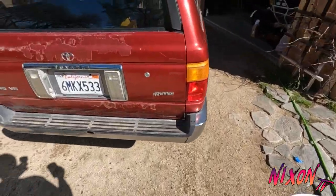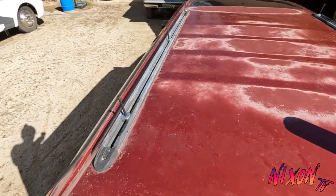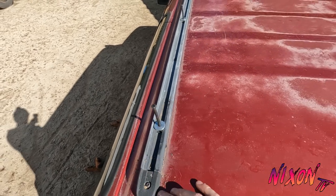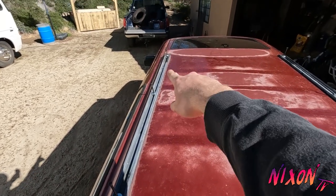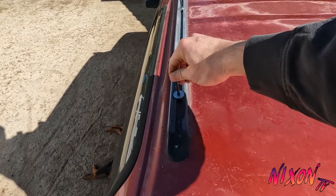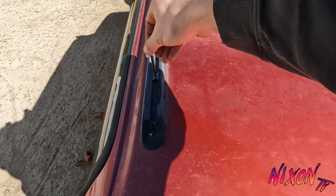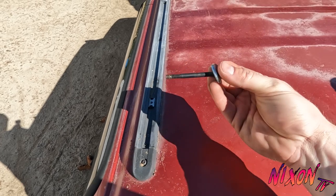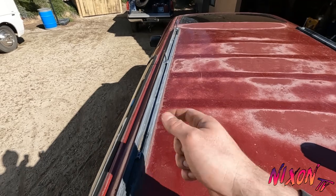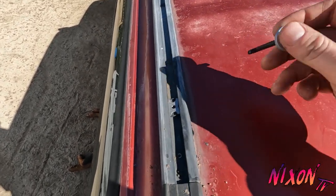I'll show you a look at the mounting hardware really quick, just while I'm here. So the way I'm doing this is, this just has the factory rails that go, not the full length of the roof, but the majority of it. And I went and bought these grade 8 bolts. They are 6mm grade 8 bolts. These ones I did not have to trim, they fit perfect. Those ones I did. So basically, have these little aluminum sliders in there.